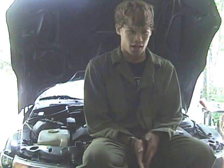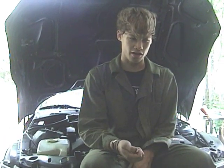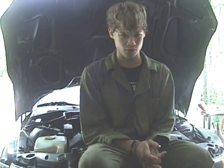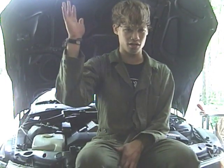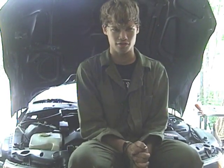Some of you may be wondering how you know if you need to replace the camshaft sensor in your car. A problem I had was, especially during cold weather, after my car had been off for at least 7 hours, upon starting the car, the RPMs would be bouncing around, you could hear unusual noises coming from around the engine, the fuel line would cut out. If you tried to stay in place and accelerate, you'd take it up to 4000, it'd cut out, drop down, go up, cut out — it couldn't have a steady flow of fuel.